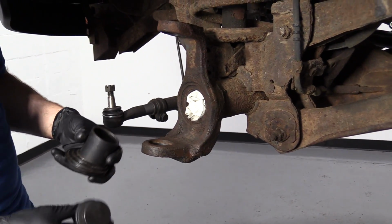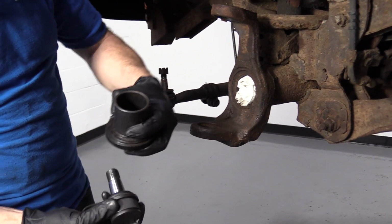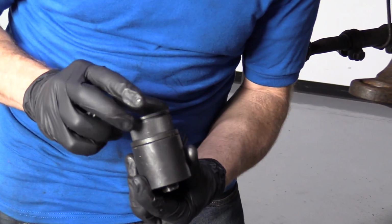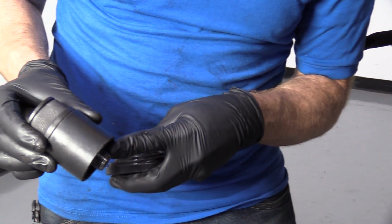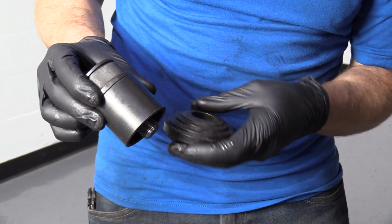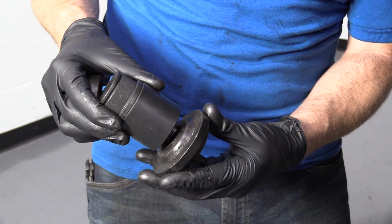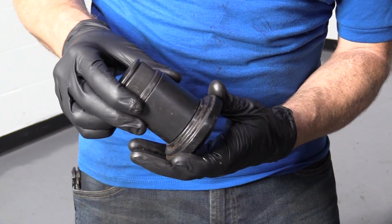We've got some cups. What I did is I found a cup that'll fit right along the edge on this. Okay. Catches it. You'll notice that the ball joint stud comes down past the cup. So you need to use the adapter that has the hole in it. You can put it whichever way you want, whichever way fits.